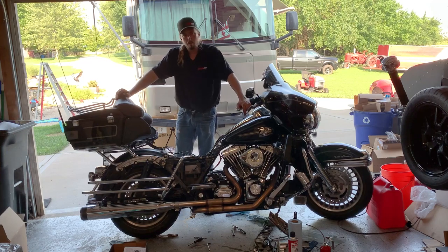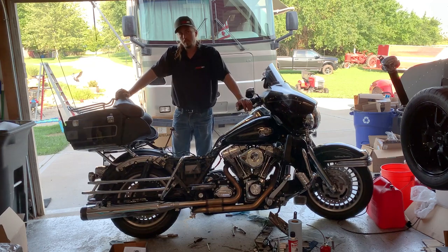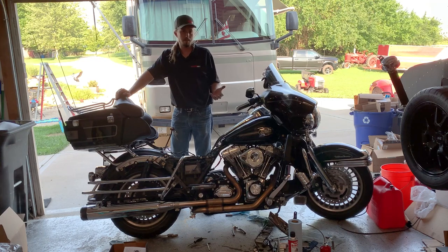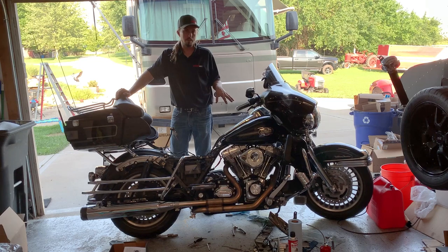One thing that I don't know if you could hear in the video or not, but when I first started it up, you could really hear what's called a piston slap. I think in a previous video when I was putting things together, I noted just how much clearance there is between the pistons and the cylinder walls with this upgrade, because you've got these very nice forged pistons, but forged pistons do need to have more clearance. So that piston slap went away after a few minutes, so that tells me that the pistons have expanded at least most of the way to make that go away.